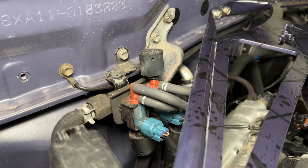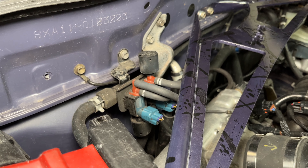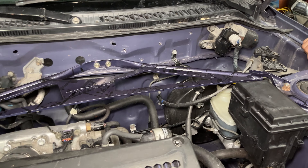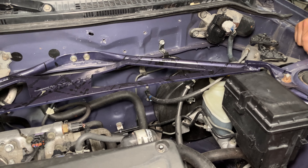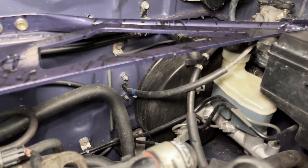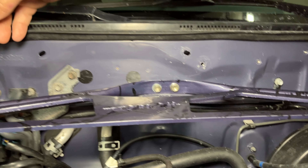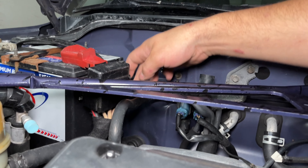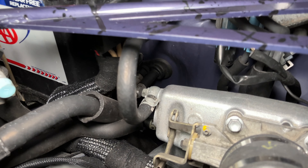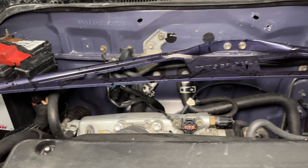That's definitely a potential issue. I haven't gotten to a point in an off-road scenario where I need the diff lock or notice whether it's working as it should. Where's the check valve for the booster — is this something you added? No, that's a factory safety system in the brakes. There's usually a check valve that runs along this booster line, either in the hose itself or on the end fitting — sometimes visible, sometimes built into the hose. It's just a one-way valve for vacuum.